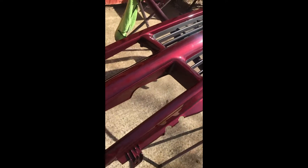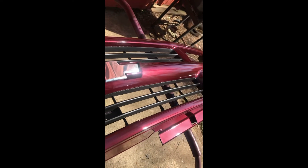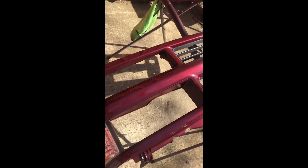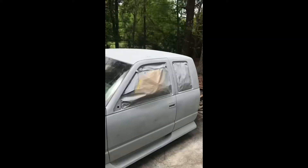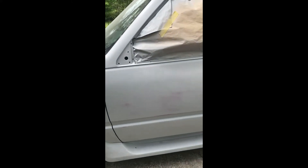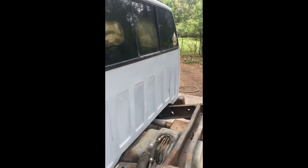The final mirror came out really nice — it's a beautiful color, showing it off in the sunlight. Over here on the grille, it's the '96 style with that center piece being a little wider and contoured. I really like having everything the burgundy color except for the bow tie. Now on this shot, we've started on the cab of the truck. I've gotten it primered with the first coat, put a guide coat on it, and blocked and cross-sanded it to try to find any little ripples or small defects.